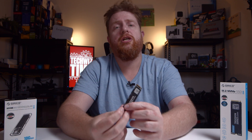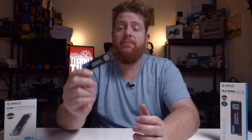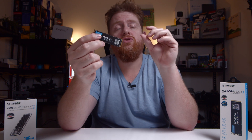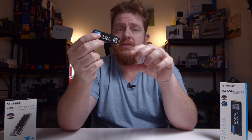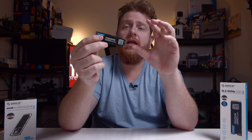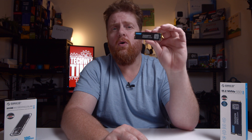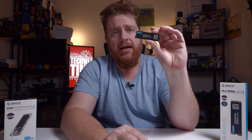The reason these devices are cheaper is because they use the 3D NAND method. Basically, they're able to cram more bits into one area versus a single bit, like when these NVMe drives first came out. So they're squeezing a lot more capacity into a smaller area.